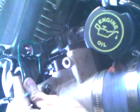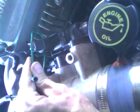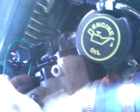One small tip mod: if you're constantly playing around with throttle position sensor voltage, just tee off the green wire. Then you can use this as a ground reference for a voltmeter off the engine here and just get a constant read, instead of trying to stick your probe into the harness constantly. Anyway, have a good day everyone.